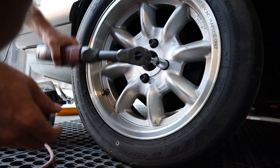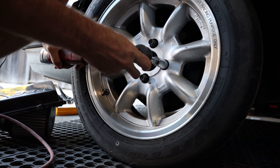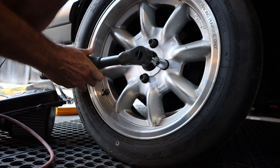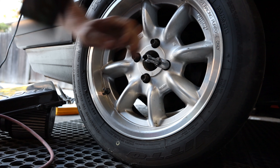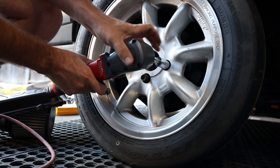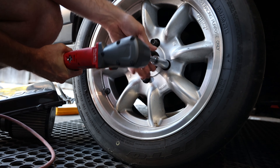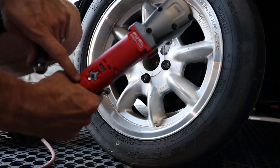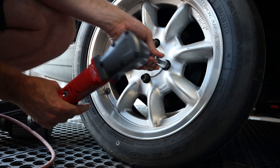See how that ripped out of my hand? It was actually tightened — but these are pretty good about that, though it can still happen. When I loosened it, it had that 55 foot pounds and I'll have a little more control this time. It does stop at 55. Now I'll tighten it back up and show the difference on the right-angle impact. Going on slow mode in reverse — see how slow that was? That's the high-control mode.